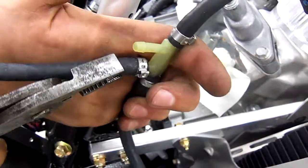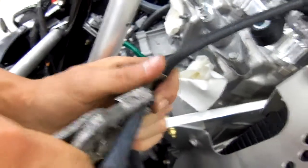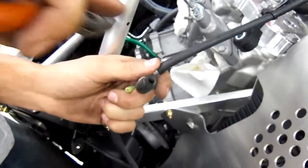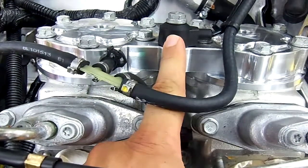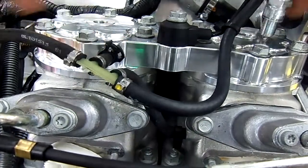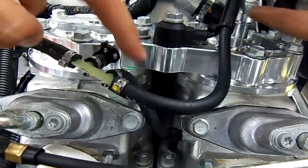The key on the coolant bleeder hose is we need to swap out the two hoses going from the cylinder head and the cylinder. Just take the long one and put it on the other side, and vice versa for the short one. The head bolts are torqued, the detonation sensor is reinstalled and tightened, and you can see how we've changed the routing of the coolant lines since the nipple comes out on this side instead of the middle — so we flip-flopped these two hoses.